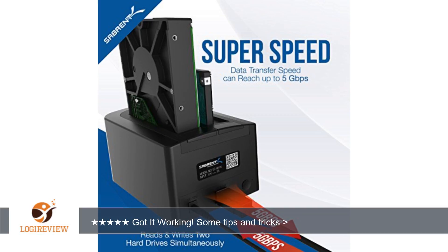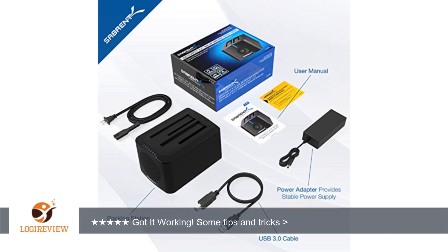After you clone a smaller drive, you may need to go into the admin tools storage tool to expand the drive's space. Cloning a 1TB drive onto a 2TB drive will leave you the same 1TB of space you had before until you expand the partition allocation.